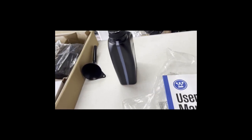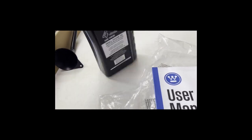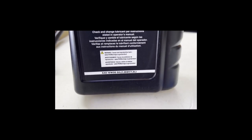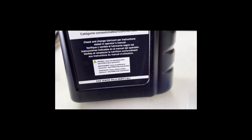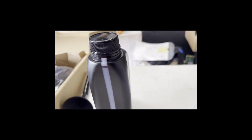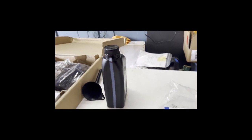Had the oil and the funnel in there also. So 10W30, it is 1.26 quarts, just a little over a quart. I actually marked my bottle where it's at, so I've got some five-quart jugs of oil, so I can just pour it in there and have it ready to go whenever I need to change.